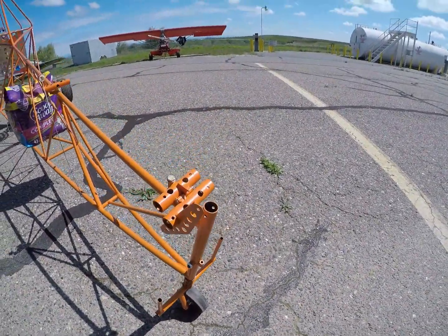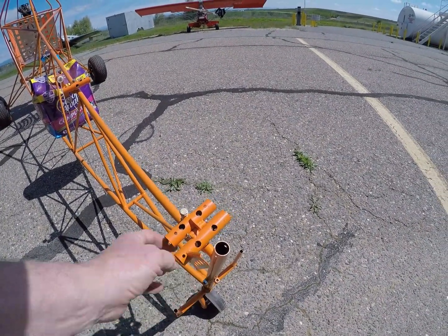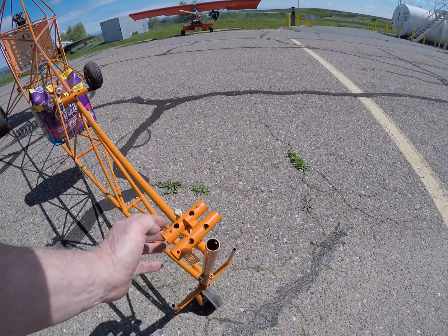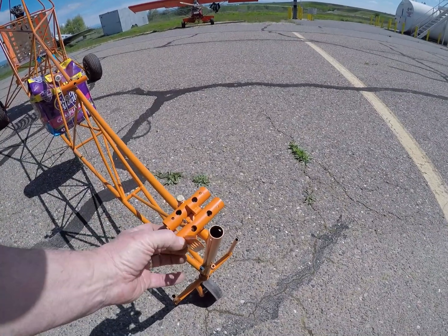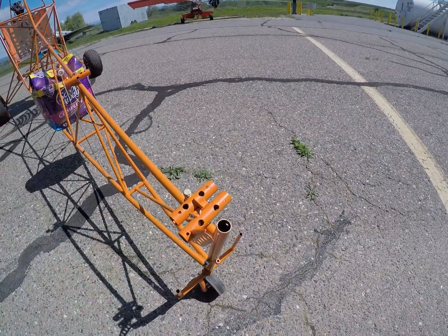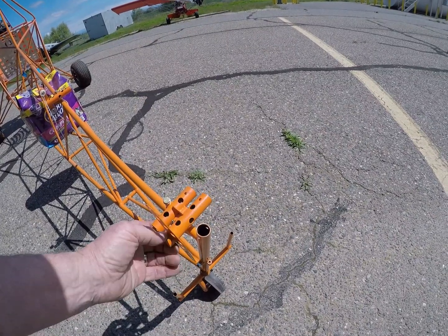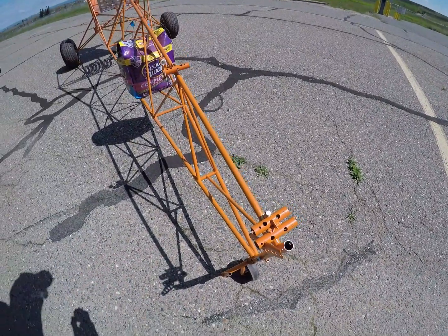I do something a little bit different starting right here — I put a hinge here because when I take the airplane apart to put it in the trailer, I don't want to take this part out or take cables loose. I'm going to pull four bolts and pull that out, so this part stays on the airplane. It's got the stops built in and then I've got the hinges out.